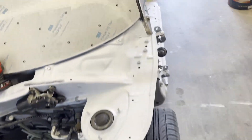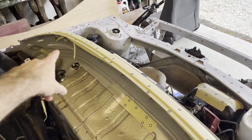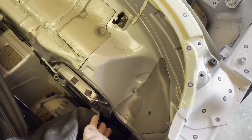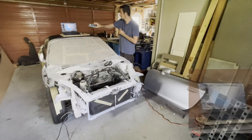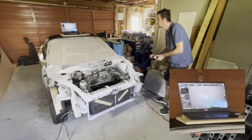If I've got time, I'll also scan the interior area in there — that'll give us a bit more information about where we can put a roll cage and how we can mount it. The scanning process starts by doing multiple small sections that have an overlap, and then in the 3D scanning software you can stitch all of these sections together to form one larger scan.